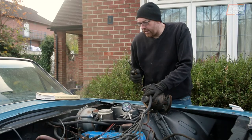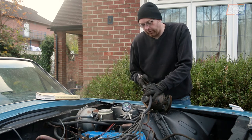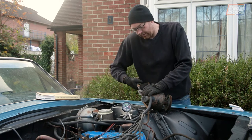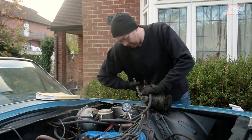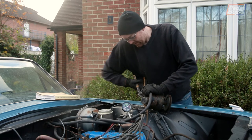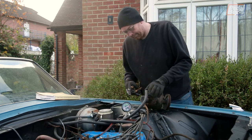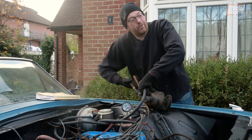We were about to take the pipe off, then we realised that if the wipers are working, that must mean the system is still full of hydraulic fluid. So as soon as we pull these off, it's going to drain hydraulic fluid everywhere. I'm just going to have to crack this off with the grips — it's completely solid, we've already undone the little Jubilee clip — and hopefully not pour power steering fluid over the entire car.